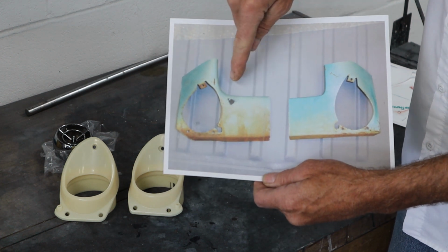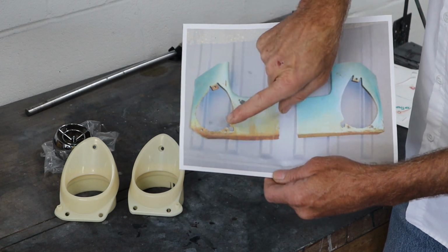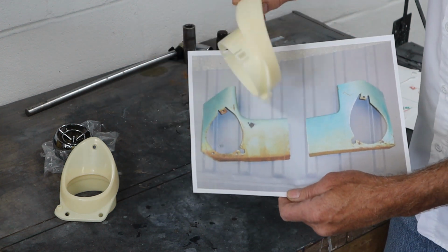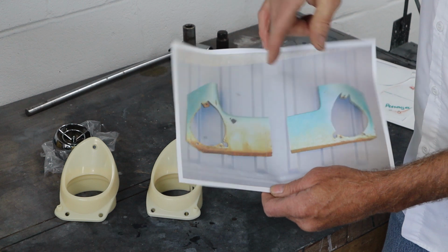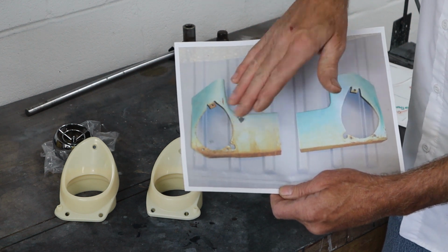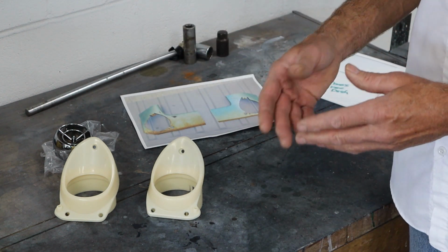But here's a picture of where somebody has actually cut the pieces off an old 65 Chevelle dash. So what I'm going to do is scale this and take some critical measurements, because I need to know where to hold that template exactly to cut this hole, because the way these are shaped, it has to fit on that part that rolls over perfectly. So I want to triple check and make sure I got these at the right height and left to right. That's the plan, and I'll put all this information in the link in the description.